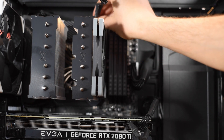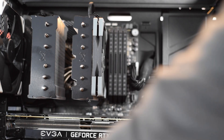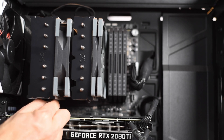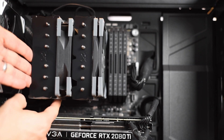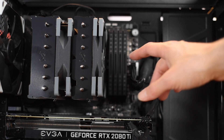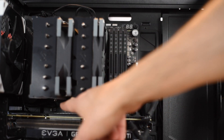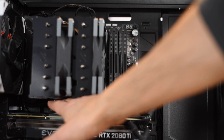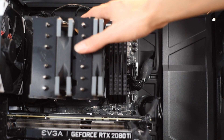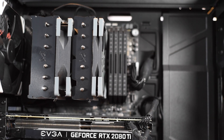There's plenty of space around the cooler to reach your motherboard — no trouble at all. I'm saving the other connector for the second fan, which I'll install right now. Thanks to the ingenious design, you can actually install this fan ahead of time rather than dealing with little fan clips while they're in your case. I really like the innovation that Scythe has engineered into the top plate. Thanks to that slim fan in front and the big offset, there's perfect clearance even for my ultra high profile RGB RAM. There's also plenty of clearance underneath for the first PCIe slot, clearance above the cooler to get your hands in and work with the cables at the top of your motherboard. I can't emphasize enough how easy it is to install this cooler and how well designed it is to fit in modern systems.